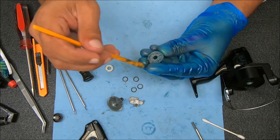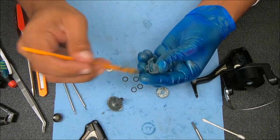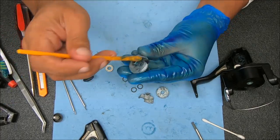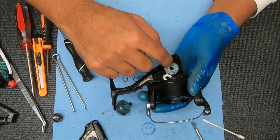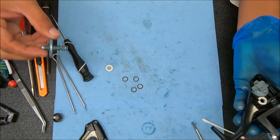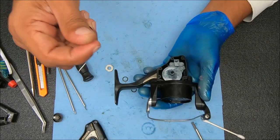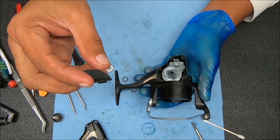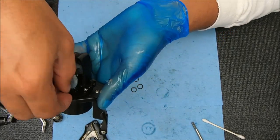And I'm going to do the same for those two gears as well. The only difference here is I'll put a decent amount of grease inside there also. Now we're going to put the oscillation gear first — put that point all the way down to the bottom. Take this block, the way it's going to sit is looking just like this. Take our main gear or drive gear, stick that in, and when we get to here we're going to take this plastic piece — notice there are two indentations curved in on it. The one to the farther right would be facing over the drive gear, so we're just going to drop it in place.